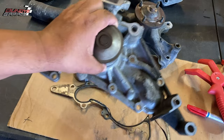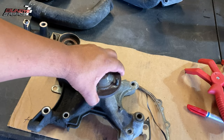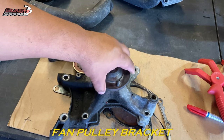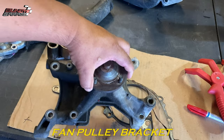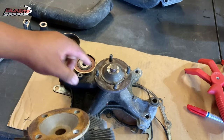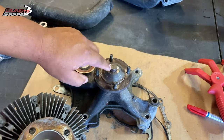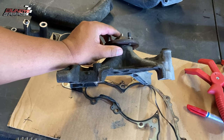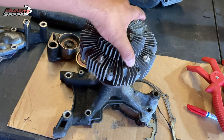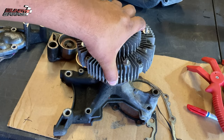One example of that — I have the water pump right here. But this is the carrier assembly; I'll put up a title of what it's actually called. This is where your fan clutch rides on, right in front of the water pump. Here's my old fan clutch that I took off. What happens is you have this recessed area that gets put in right there, and it rusts — it gets rust in there. I had to battle this thing to get it out, and it took me probably a good couple of hours to get it unstuck.